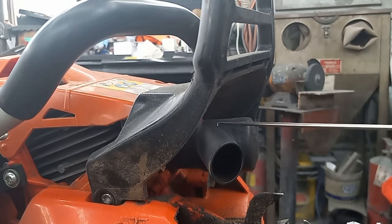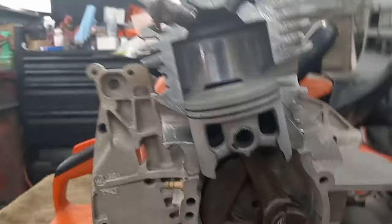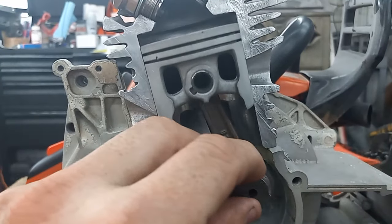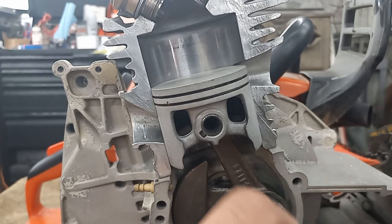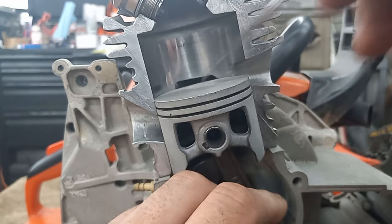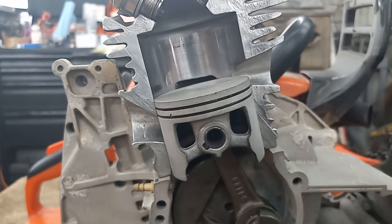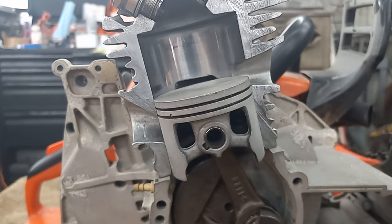Pipes like this create pull and high port velocity — they're hard on the ears, but it depends on what you want. To summarize reversion: when the piston comes down, if the exhaust gas pressure is higher than the crankcase pressure when the transfers crack open, it will push exhaust gases down the transfers, and you lose a tremendous amount of what could be free horsepower. I don't claim to be right or wrong. A good safe set of numbers: a free-flowing muffler and between 100 and 105 on the exhaust roof.